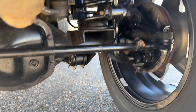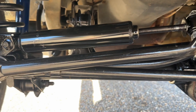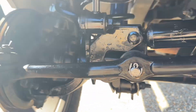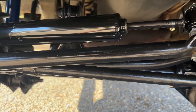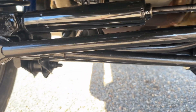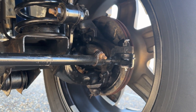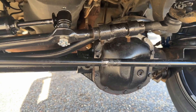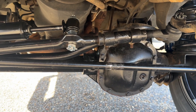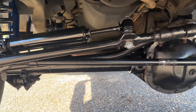The end links are in. Looks like I also had to replace the actual steering stabilizer shock because it was a disaster. The only one I couldn't get to is this one right here because it's the entire arm that would have to get replaced, and the ball joint was still pretty good. All in all it wasn't too bad — about three hours of work just to make sure everything is torqued down correctly. I'm headed over to the alignment shop.